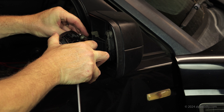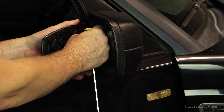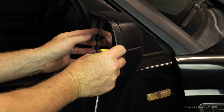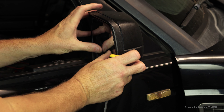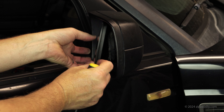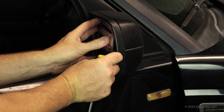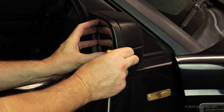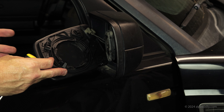Because the mirror is gone I could just go in here and pop it like that, but if you can't, you can just go in from the top, grab it, and do a little spin like that. In my case it's deteriorated bad. To get the fat clip down on the bottom, just take the screwdriver, slide it into the clip, and then you can twist it. I'm just twisting — I'm not prying very hard. Then lift it up and over those alignment points. If you have to, you can squish it back down and lift it off.